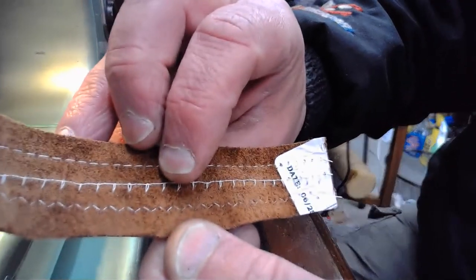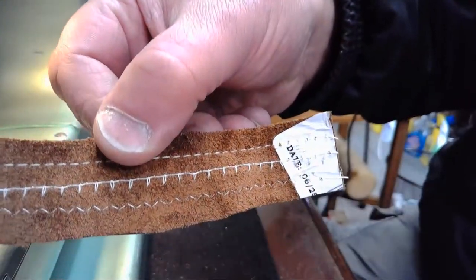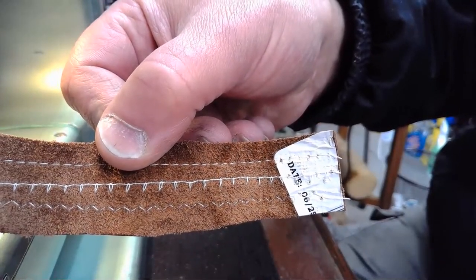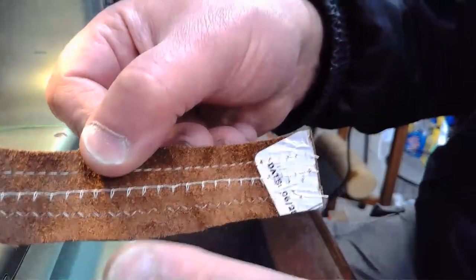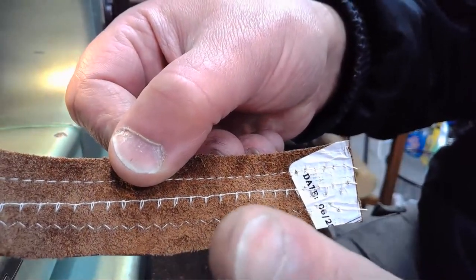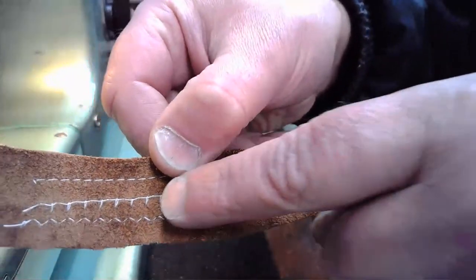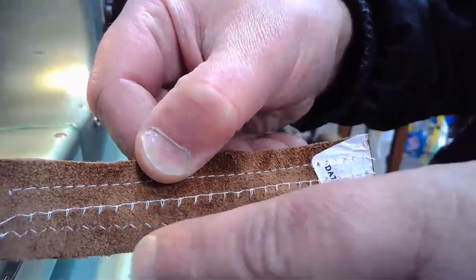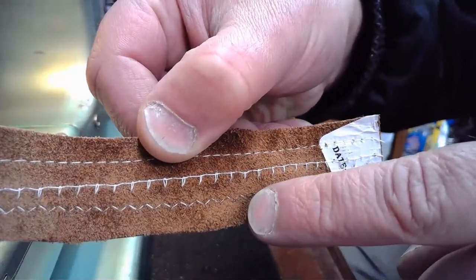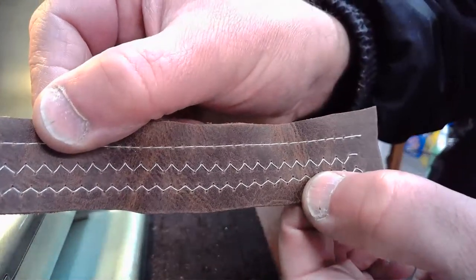And then I just adjusted it a little bit, bumped up that upper tension again, and look at what it did on this lower row compared to that middle row. It's night and day, and I only bumped it up from about 5.5 to a little bit below 6.5, less than a 1 point factor. And we went from getting this, where the lock stitch was incomplete, to this, where we've got a nicely defined lock stitch here at about a 2x2 factor. And we also have good definition on this bottom row for the top stitch as well.